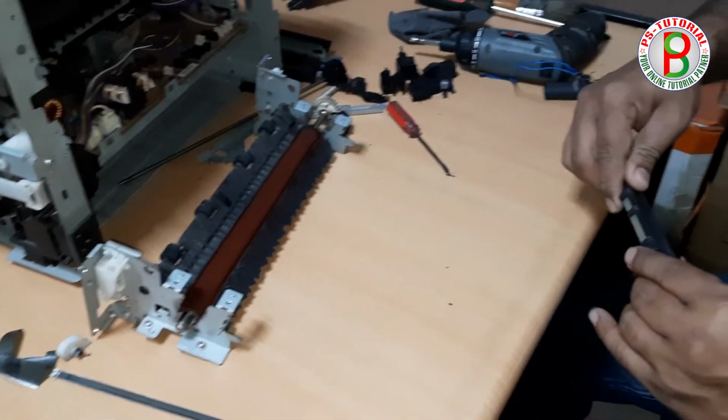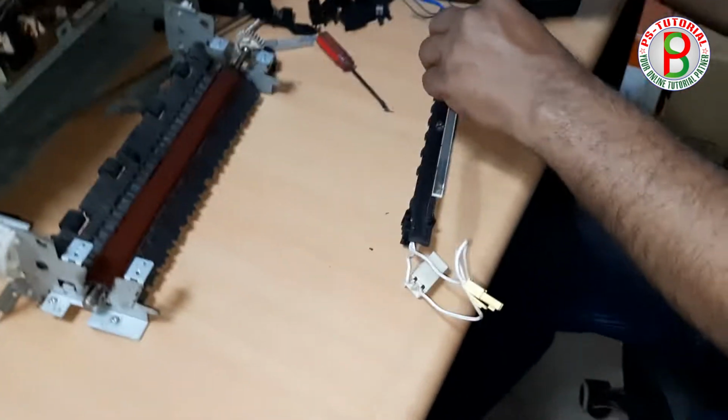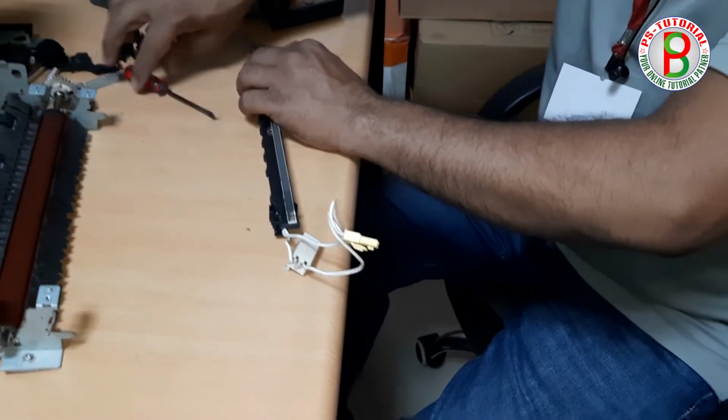Excess toner not transferred to the OPC drum is scrubbed from the developer unit and returned to the hopper to be used again on the next printed page.